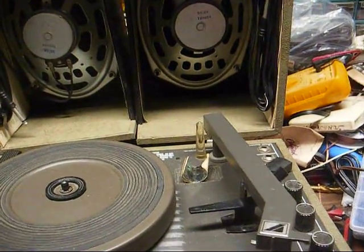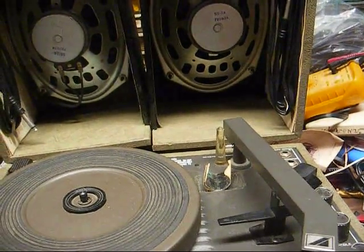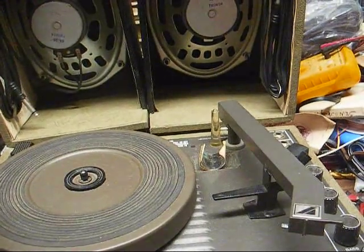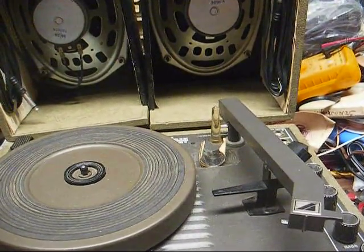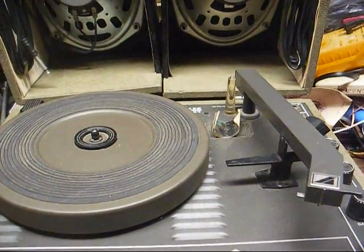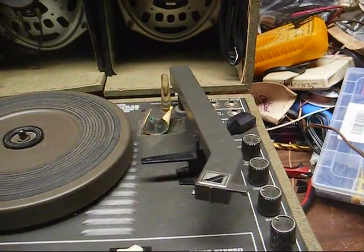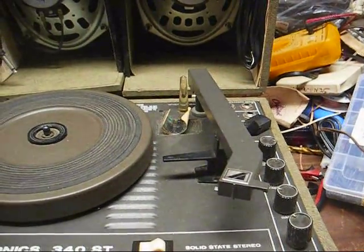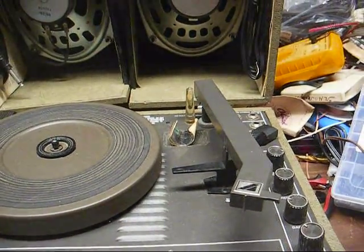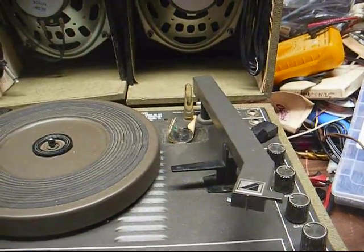That cartridge was a very popular cartridge starting in the late 50s and was probably used up until the early 80s, mainly in institutional record players, but in the earlier days of its existence it was used in a lot of consumer-grade record players — I know Motorola used it a good bit. Physically, the cartridge looks just like an 89T, which is the standard mono PowerPoint cartridge that the school record players use, but being stereo it has four terminals instead of two.